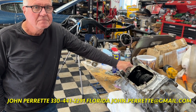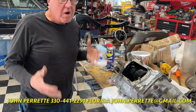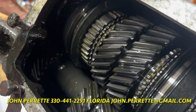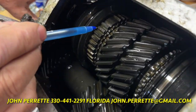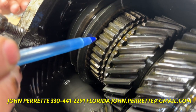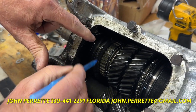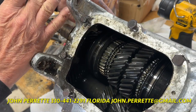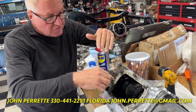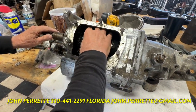We're going to go over this transmission and talk about why we're rebuilding it. We're rebuilding it because the synchronizers on the inside — this is the hub of the synchronizer right here — this is chewed up. The reason these get chewed up: this is the third-fourth synchronizer. There's play that goes on here, and that play ends up creating a bind, partially because the transmission is bolted to the bell housing and you get a little bit of flex. As a result, these synchronizers are usually bad or scored where the splines are. That's the primary reason.